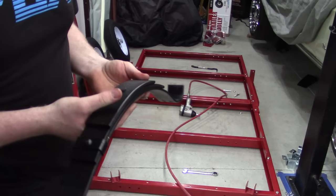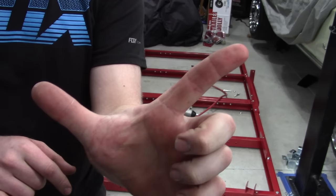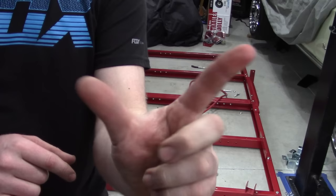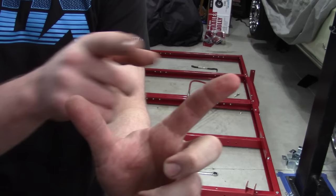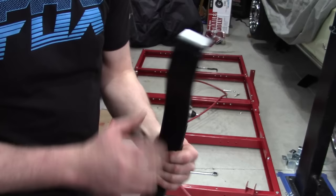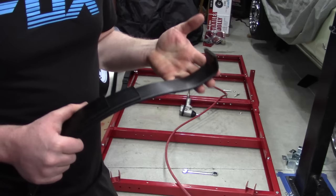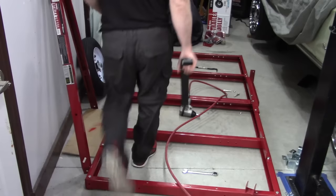Think of a U shape — that's your spring. When you load up the trailer it's going to spread apart. When you hit a bump, one side is attached via the eyelet at the front, and the other side just slips on the frame. After a while you'll notice wear on the leaf spring thickness and where it rubs on the frame — just keep an eye on it. You can always weld a plate to the trailer frame later, and if the leaf springs get too thin, just replace them — they're not that expensive.